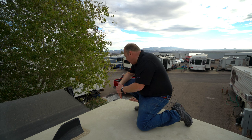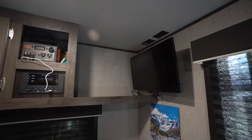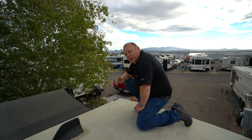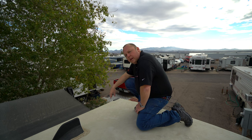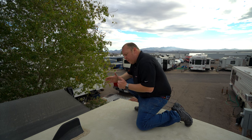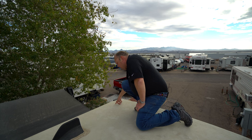Welcome to the roof of Caitlin and Casey's RV. We're at the back end of the trailer where they have a compartment with a TV mounted — that's their electrical control center and where they keep their Pepwave, so that's ideally where we want the wires to enter. Inside that cabinet there is 12-volt power with a cigarette lighter adapter. Common places to find 12-volt power in an RV include a powered or boosted TV antenna, a cigarette lighter plug, or possibly a light switch. The Pepwave Mobility 42 requires about five to six inches from the edge for the hole, and we've marked our spot here.